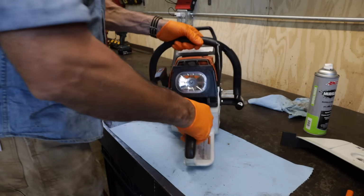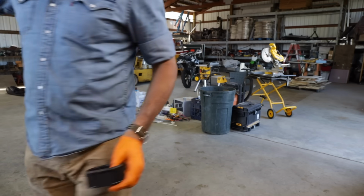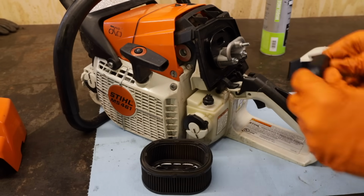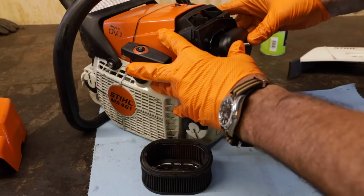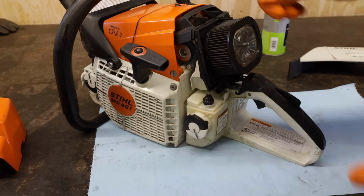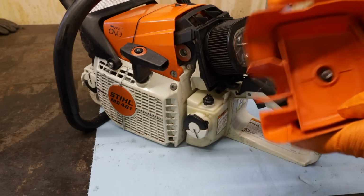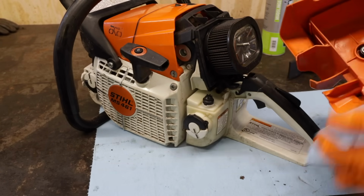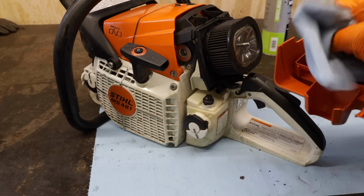With that side all sorted, let's take a look at the air filter. Okay, so that looks a lot better. Don't know what this little guy's for. Clean filter, and I will replace these every 3 years or so. Actually, I keep a couple on hand. Make sure you clean out the inside of the air box as best you can. Of course, anything that's in your air box is going to go directly into your filter.